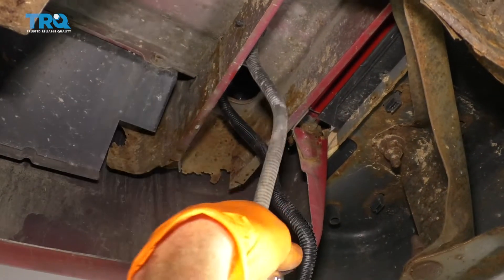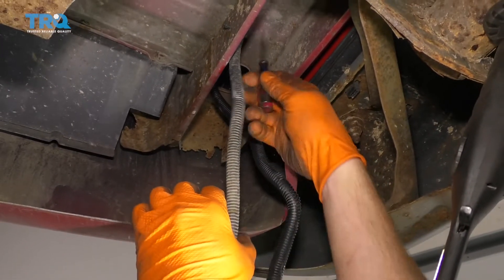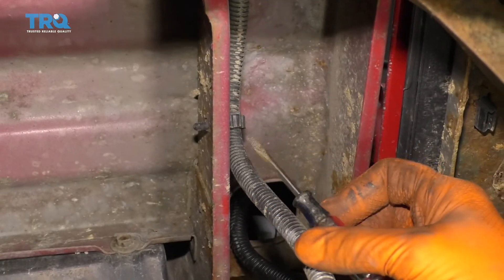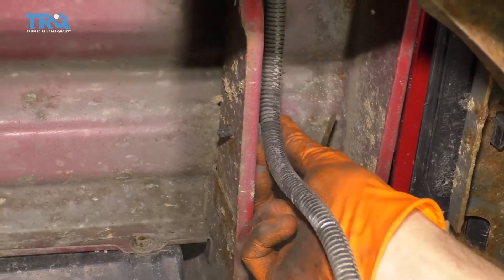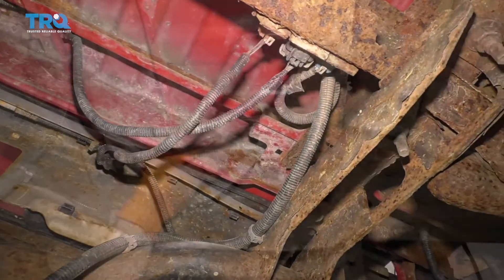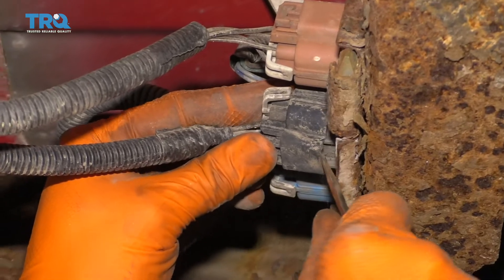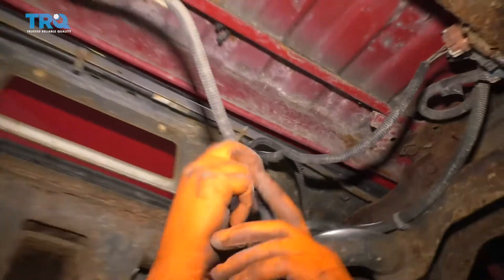We've made our way underneath the vehicle. If you grab onto that wiring harness, you're going to notice it's secured in several places. If you look right up here, you can see one of the supporting points. Just take a nice small pocket screwdriver or whatever you might have, get in between here, and separate the two pieces — this should come right down. Do the same right on down the line all the way until you get to the end. Go ahead and squeeze this tab, then draw it off.